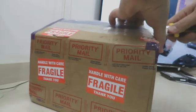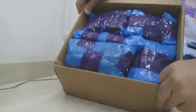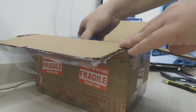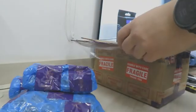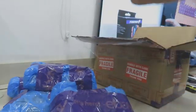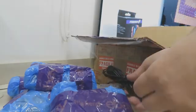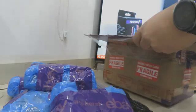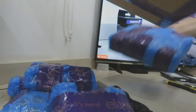The problem is that most Super Nintendos that came to Brazil in the 90s were transcoded to the PAL-M system. They were originally in the NTSC system and they were transcoded to the PAL-M system. That happened because the TVs that we had back in the 90s didn't support the NTSC system. They would look black and white on a PAL-M TV. Though the PAL-M system was technically better than NTSC, the transcodification process was poorly done.